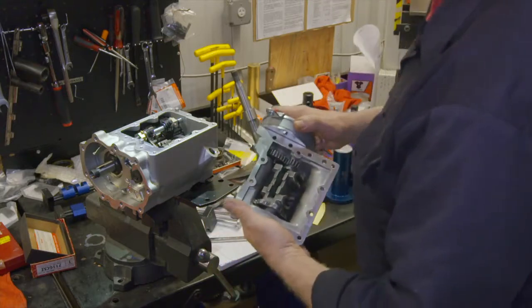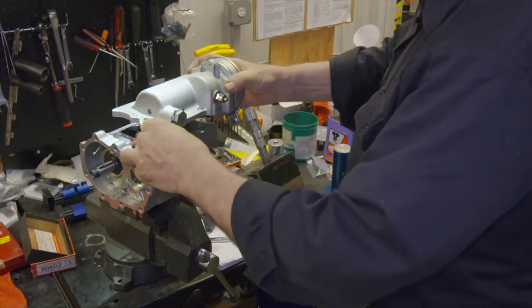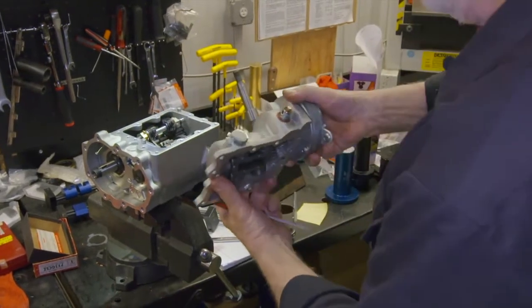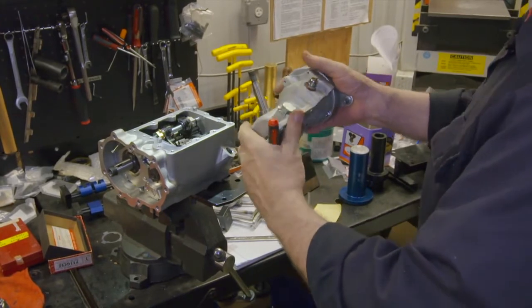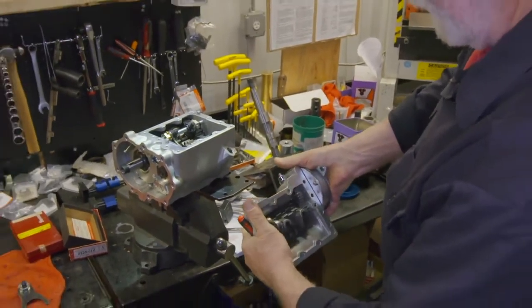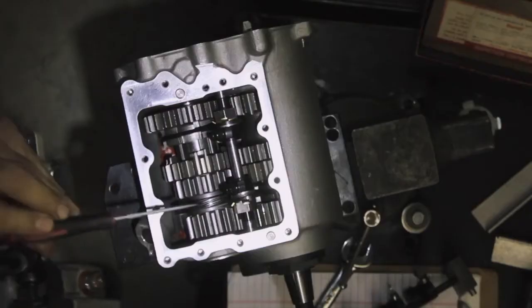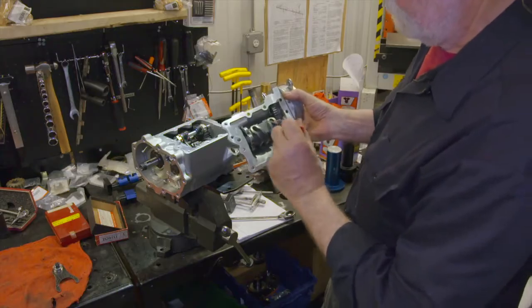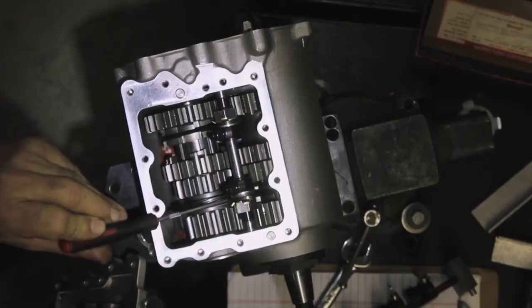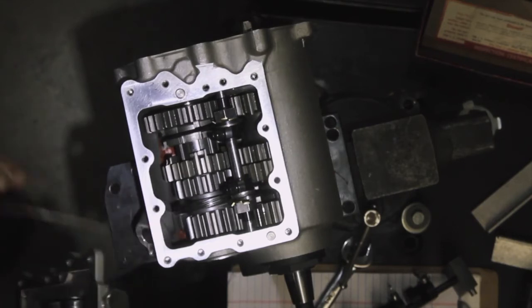In turn, this would be mounted as such on here. As we move forward now, I'm going to toe up now for second gear. I'm going to pass the neutral slot and go into second. Now in turn, we still remain on the main shaft in a neutral position. This fork is still centralized with the dogs between third and fourth gear.